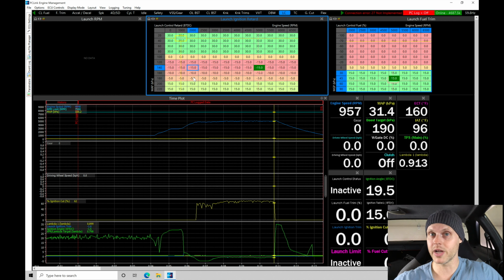timing. Now, I could raise my RPM here from 5,000 to 6,000, and I could probably build another 5, 6, 8 pounds of boost using the same ignition timing that we're commanding here as the absolute timing in the table. You always have to experiment with that. So as you raise your RPM, you may have to adjust your ignition timing.